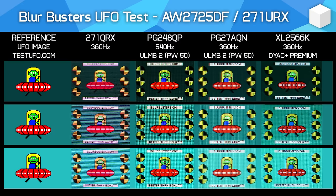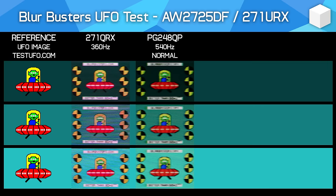That's without backlight strobing though. When we introduce strobing to the LCD comparisons — ULMB2 and ELMB Plus for example — typically an LCD will have better clarity. The PG248QP image at 540Hz is noticeably better and in the lead, but edge clarity and strobe cross-talk is better from the AW2725DF QD OLED, with better text clarity on the 360Hz strobed LCDs. What's also important is the Alienware model can achieve this clarity while HDR and Adaptive Sync are enabled, whereas the best LCD strobing implementations only operate at fixed refresh rates without HDR.